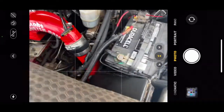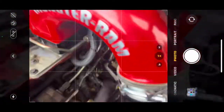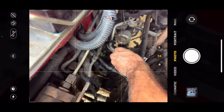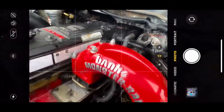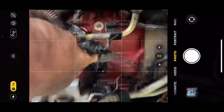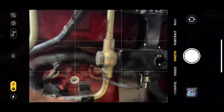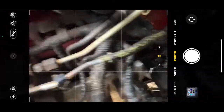Let's get around. I'm gonna use this extension right here to point at it. That right there is the electrical connector for the oil pressure sensor. Yours might be harder to view — I have my fuel bowl deleted and stuff. So I'm just gonna stick my phone right underneath the intake horn, move this stuff over to the side here. That's it right there. That's the sensor underneath my fingers there. It's kind of a rough location — it's right there, right underneath the intake horn.